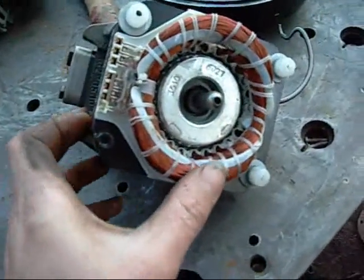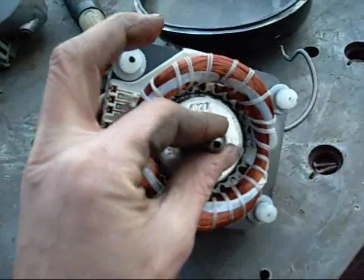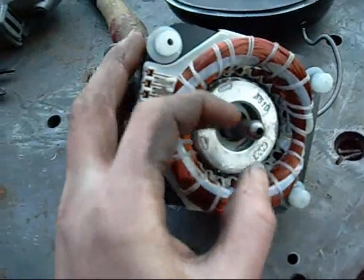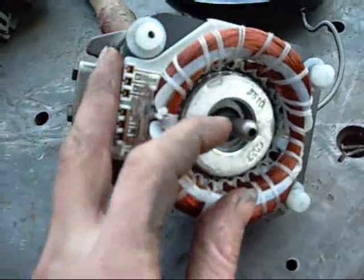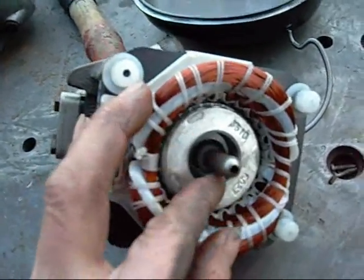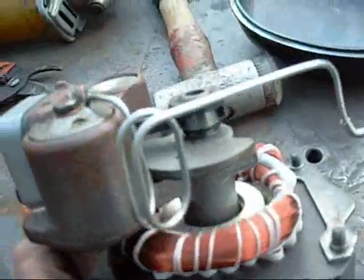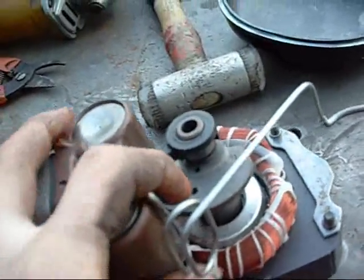This is the bottom end. There's obviously no motor bearing or anything down here; the motor is reliant on one single centre bearing. This little tube here is your oil pump. Oil floats up inside there and as the motor is running, centrifugal force and a little spiral baffle inside drive the oil up inside the motor spindle and out through the top, through the motor bearing and the crankshaft bearing. You can see a couple of little holes here for the spraying.